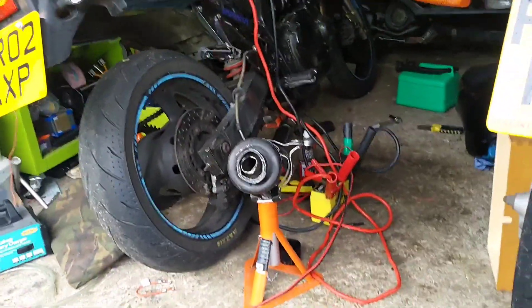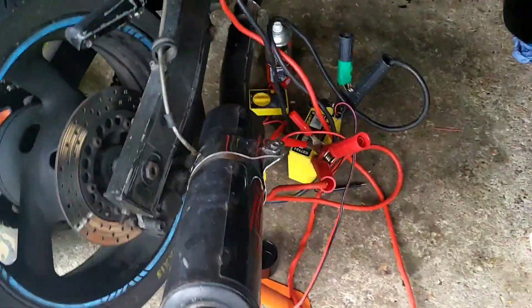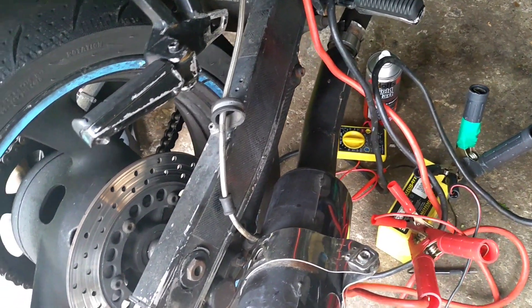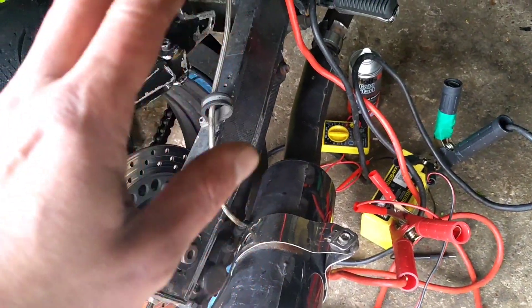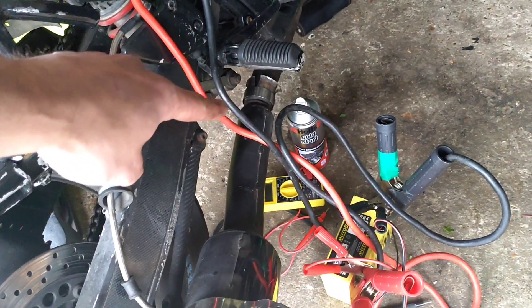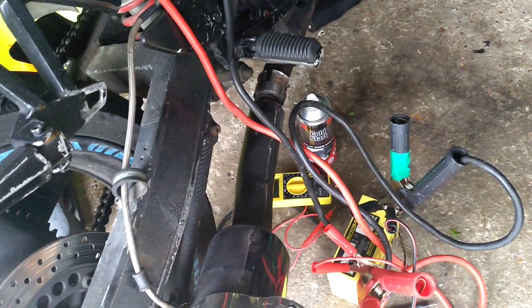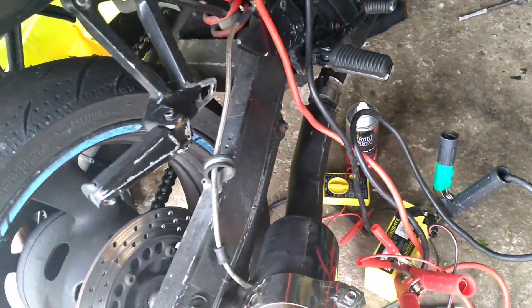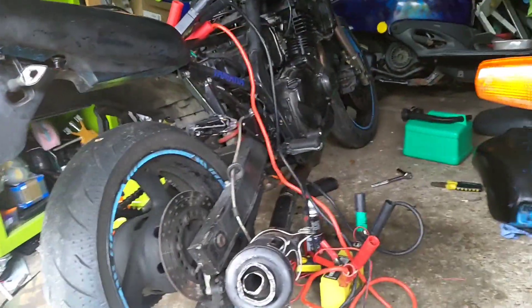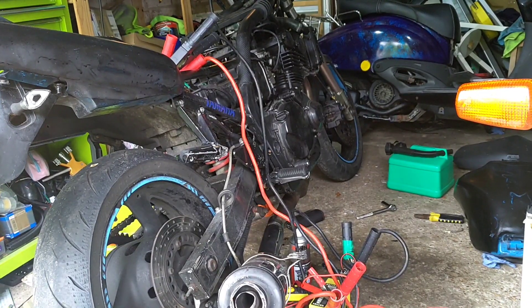That exhaust was just tagged on - it's the wrong one. There's no link pipe, so somebody has just tried to ram it on without a link pipe and it won't even go to the right angle. I knew I was going to need a new exhaust anyway, but it physically doesn't fit. It's a straight pipe going onto a straight pipe - you can't get it to bend up here unless you have a bend in the join. I've just had to tag it on at a really rough angle to get anywhere with it.